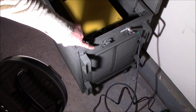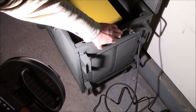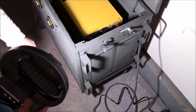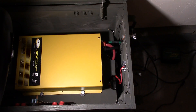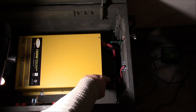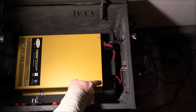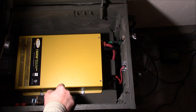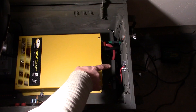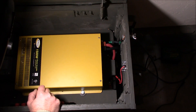Right on the other side of the box here, this is the SAE connector I had for the solar input, and now it is wired for the battery tender 24 volt charger to plug into directly to the batteries. Here's the backside of that SAE connector. I've got these wired right into the battery - the Trojans down there. I had it color matched up real good - the red was on the positive, the black was on the negative. And when I plugged in the battery tender, it had a reverse polarity signal. So this Chinese-made power outlet socket is wired backwards. Luckily I found that.